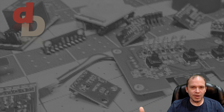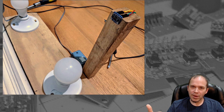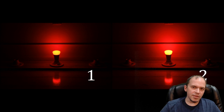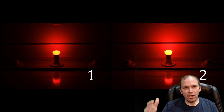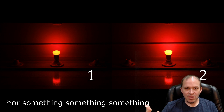Just like we did in our smart bulb comparison video, we took the lux sensor, placed it on the little wooden post, and took readings of every single channel. For the warm white, we couldn't compare it to the previous Lohas bulb, so we chose the Riofu bulb and compared those two warm whites together. We also used the DSLR camera with all automatic settings turned off to find a good setting showing the true brightness and colors of each channel on each bulb, so you can see the data and decide whether the newer or older version is better — or if it varies by channel.